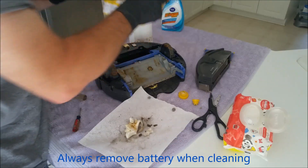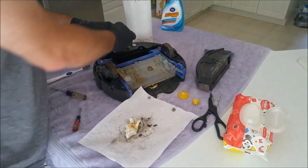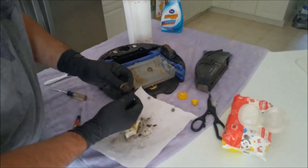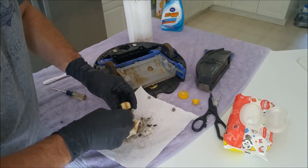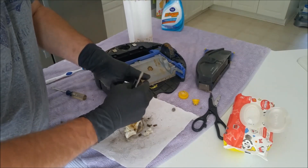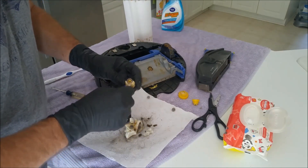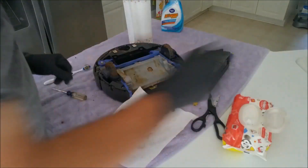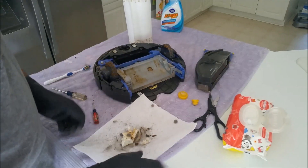I'm going to remove the battery and set it aside. The battery is normally unaffected. The front wheel is definitely packed up here. To get this out, you want to get a good grip on the wheel and give it a tug. I'm using my thumb to give it a little push — the wheel comes out. There are bearings inside and it's not good for water to get in those bearings, but at this point it's that or dispose of the wheel. So I'm going to wash the wheel and the wheel hub — all going in the sink. At this point I'm left with the base Roomba, and most of my problem is currently in the sink.